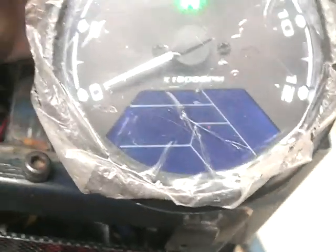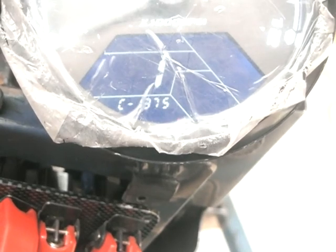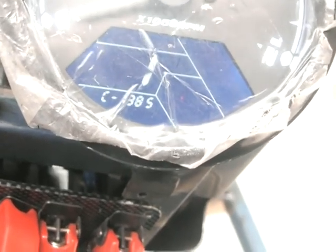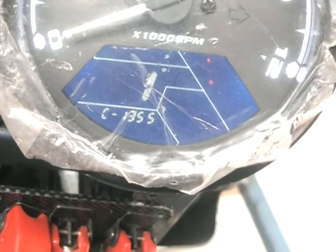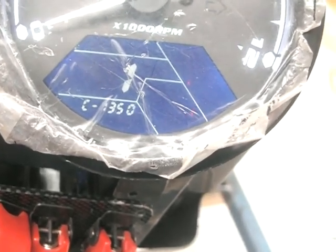Restart it with the button pressed at the back to get into mode 1. When it starts flashing on the 9, I simply press the button at the back to get the right value. I want 1,350. Now I'll just wait and it will toggle over. Simply press the back button — 1,355 is getting close. Wait for the last number. So mode 1 is the circumference — there we go.